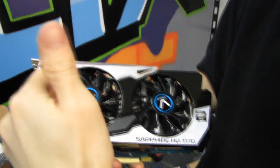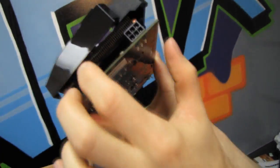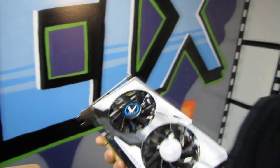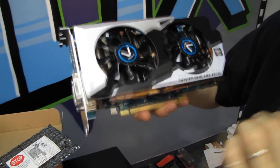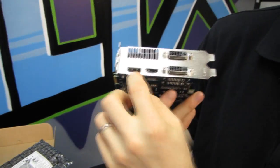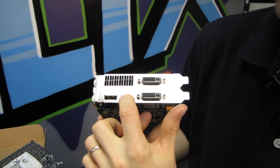This is a very large cooler — fins span the entire length. It's actually a pretty short card and uses the older style placement for the PCI Express connector, which is fine since interference with hard drive bays shouldn't be an issue. It uses dual 80mm fans for cooling. We have the PCI Express 3.0 16x slot and up to four display outputs: 2 DVI, a full-size DisplayPort, and HDMI.